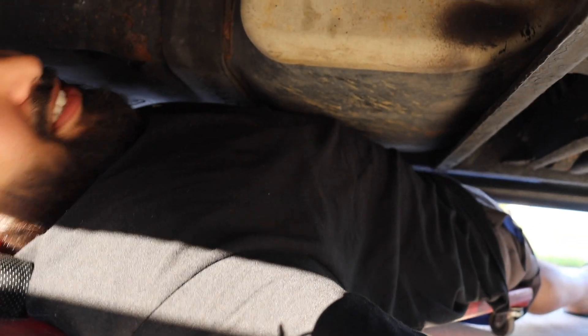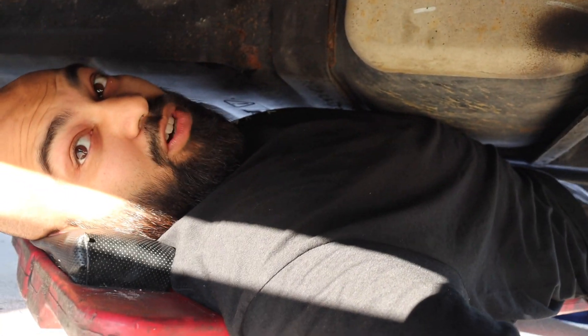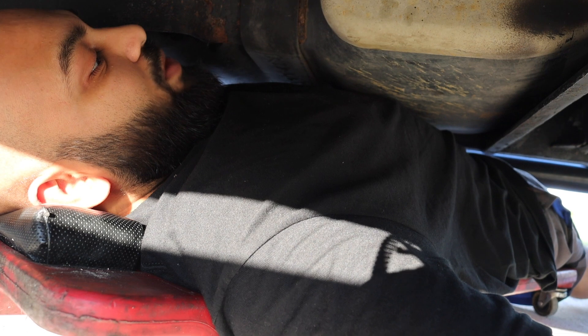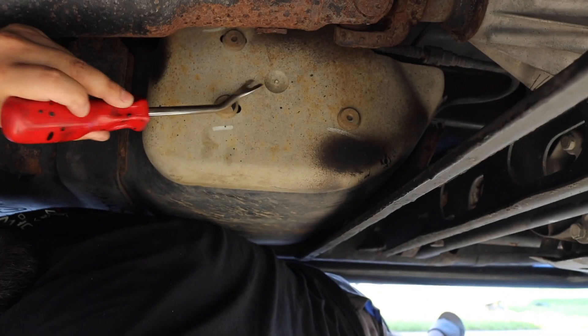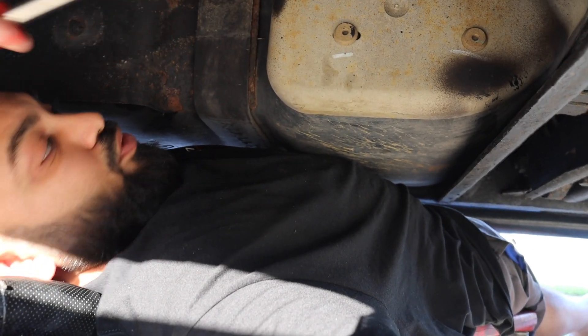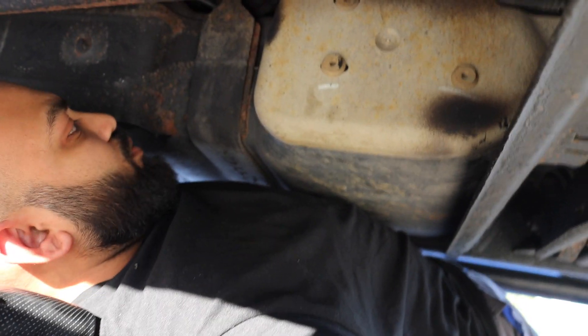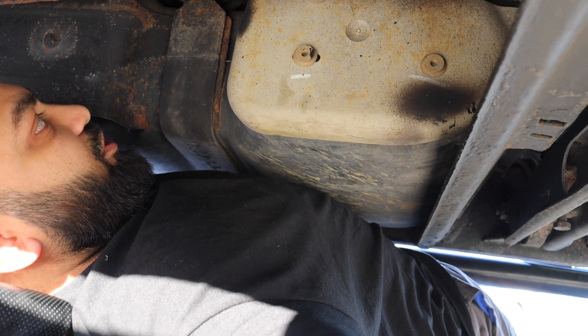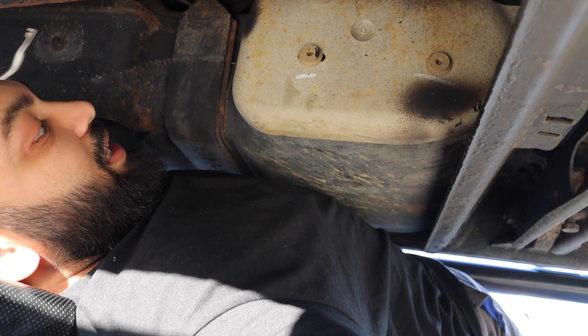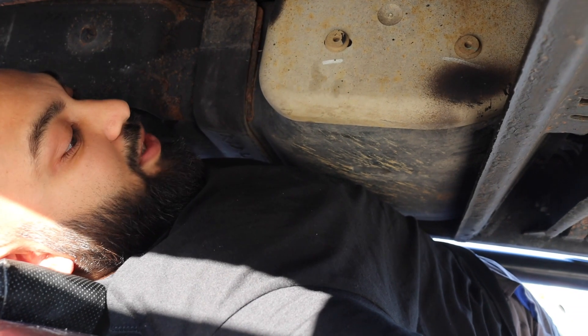We are underneath the Avalanche and it is mighty tight under here. I actually didn't even jack it up because I believe the gas tank is thin enough that it can slide under the truck without having to be on jack stands. All I did was chock the two front wheels just to be extra safe. I want to remove this plate here — it looks like I can just pry it out with a pry tool. This plate should come off once the straps are released. We also have to remove some fuel lines, evap lines, and whatever else is going to the tank.